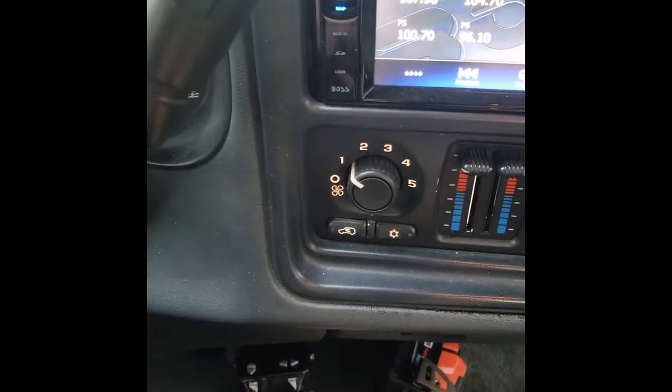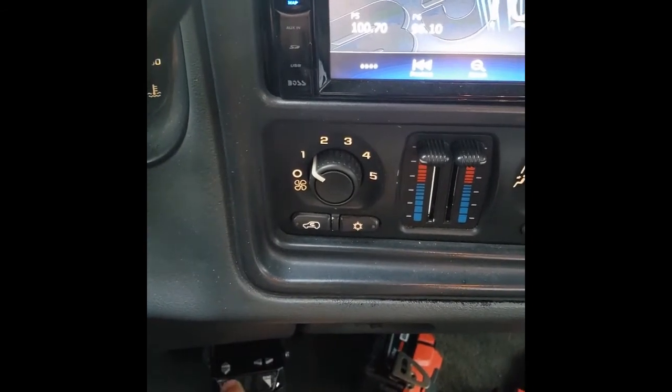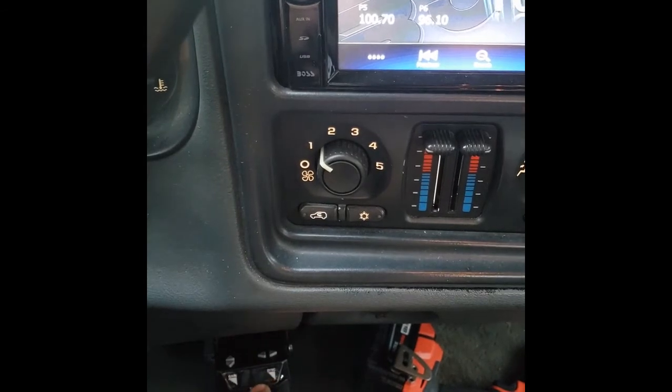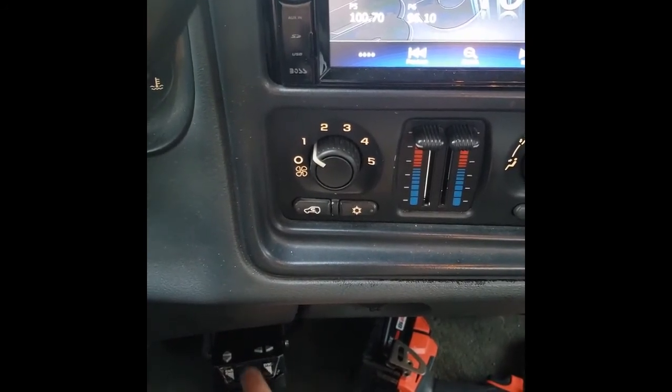So that'll help. Now, this will actually illuminate when I pull the lever. That's telling it's engaging the brakes. And then my other two things here, my sync and my gain, I will adjust those accordingly when I actually hook up to the trailer. It'll monitor the brakes, see the kind of brake system that's on it, the number of axles, and I can adjust how fast the brakes apply and how hard they apply.